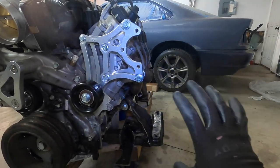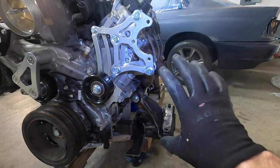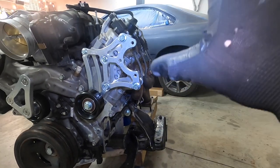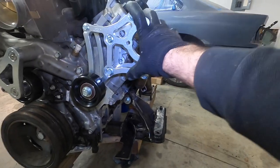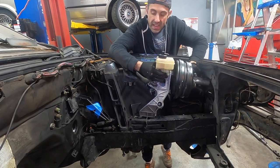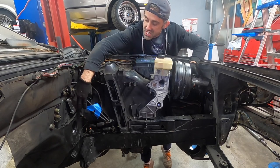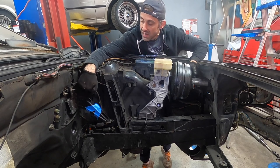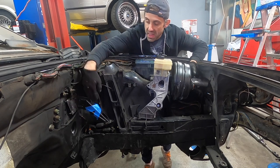The brake booster is right in this area because we're gonna be using the E34 540i brake booster remote assembly that connects the firewall to the brake booster out in the front behind the driver's side headlight. The trick is to make sure the position of the actual booster does not interfere with the pump. Here is the booster assembly. Some modifications to the frame rail underneath are gonna be required in order to get this thing to dip down below. This here is the bracket that mounts to the firewall.